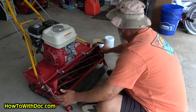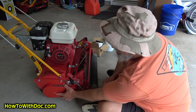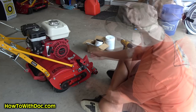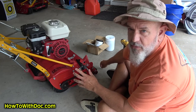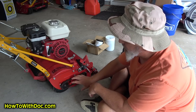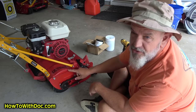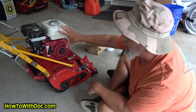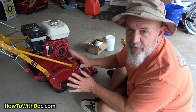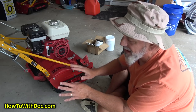So how do you back lap this? It's pretty simple. I'm going to take two screws off here, take off the chain. A lot of reel mowers — True Cuts, McLeans — sell a back lapping kit which you can attach to use the power of the reel mower itself. I never sharpen a reel mower blade with the power of the unit — I think it's too dangerous. You might engage the unit with a roller and too many crazy things can happen. My recommendation is you always use some kind of manual drill system. You have better control and it's a lot safer.